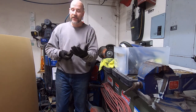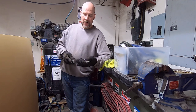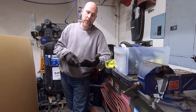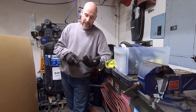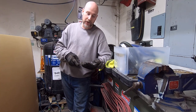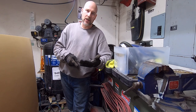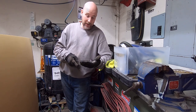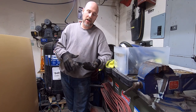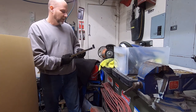And I can tell you a way to test this stuff, especially if you're in your garage with your lights. Really look at that with the light reflection in there, and if you see cloudy spots in that light, keep working on it. But like this, I can see the reflection of that light, all of it in there, in very good detail. So this piece is very good. Usually stainless will look a little bit better outside in the sun. So if you got it really good in your garage under the lights, it's going to be a nice finish.